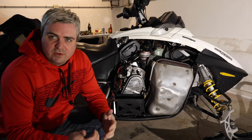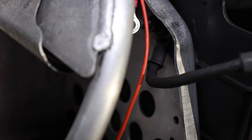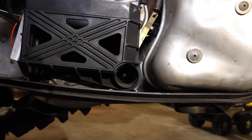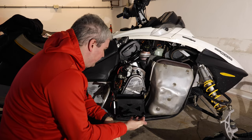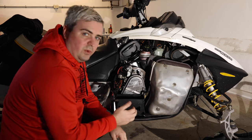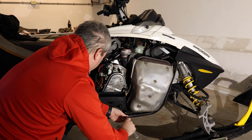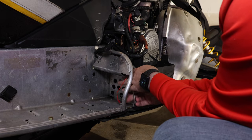Take the battery box out. There's going to be two screws that you need to take out. There's going to be one over here, which also holds the ground screw, and there's going to be one underneath in this hole, which attaches it to the engine, the frame, or the chain case itself. So we're going to go ahead and take those out. This side is a 10 millimeter nut, so it should loosen up easily.